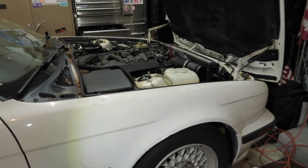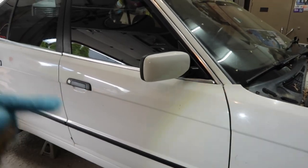I gotta finish up a couple other maintenance items, and then we're gonna start our road trip and see how this bad boy sounds. If you look at the old ATF — that's 20, 30, 40-mile ATF — that stuff is red when it's new. You can see how metallic it is. It's brown and metallic with a lot of wear metals in there. Preliminary test: I fired it up and the trans still sounds the exact same as prior to all this. So I guess I'll see you guys along the road trip.